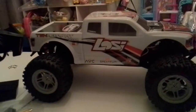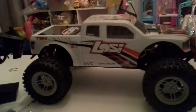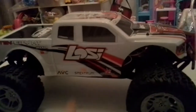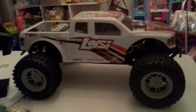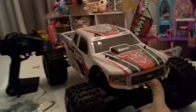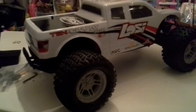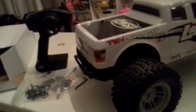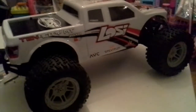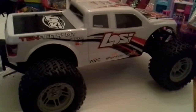I think the looks are a lot better too — it sits higher and I like the space and overall look. It's a Losi, and Losi is supposed to be good. With a few upgrades — shock caps, a new motor like a 3300kV or so — you've got that 130-amp speed controller and it's gonna kick ass. The front bumper's pretty strong; I've seen it flip and take a beating. The chassis cracking is the real concern, but I'll find a way to reinforce it. It comes with double-As for the controller; you supply your own batteries. Anyways guys, thanks for watching, I'm gonna get this Losi running — have a great weekend!